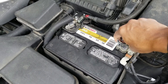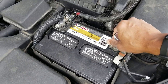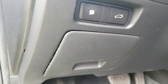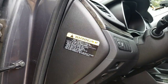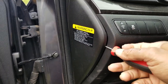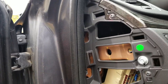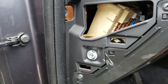We're going to disconnect the battery so we don't deal with anything exploding because there's still power — just disconnect that and tuck it away. Next, remove the fuse door and pop that side panel off. Insert and gently work your way around it and it will pop out. Now all the screws are exposed because we have to drop this whole bottom piece down.